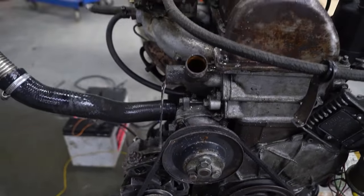Though we did notice upon removing the head that there was oil on the pistons. And that tells us that the rubber rings allow oil to enter the combustion chambers. But at the same time, there was no blow-by. I mean, of course, there were gases being expelled through the breather, but it was only as much as you'd get on a perfectly fresh engine. One that's in ideal condition. So nothing outrageous, it wasn't smoking or anything. Yet we still saw oil in the cylinders, though there wasn't too much smoke coming from the exhaust. Not to say we were running one, we just had the headers, which allowed us to clearly see the flames shooting out. Overall, these rings made for a curious effect.